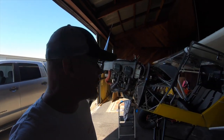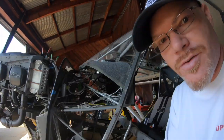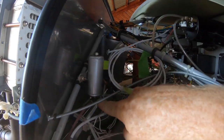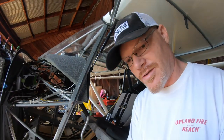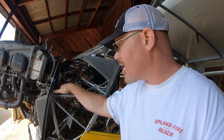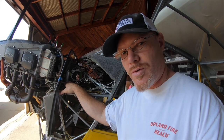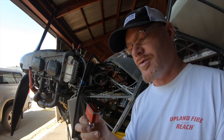For ease of installation, what I'm doing on this Model 5 versus what I will do on the Model 7 is I'm going to use the existing brake reservoir, which is located right here. There's a T-fitting out the bottom and I just found an AN T-fitting that I can put in there to replace it — these style connectors that are in here won't work. So I got an AN fitting to go in there.